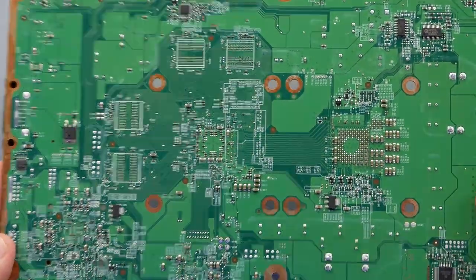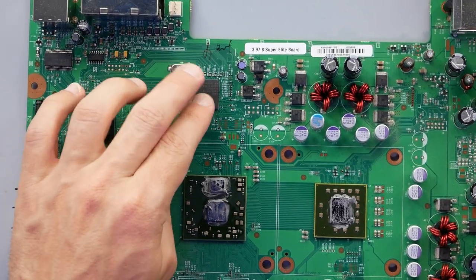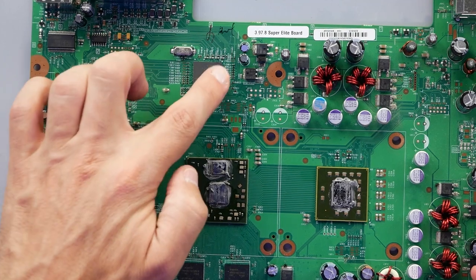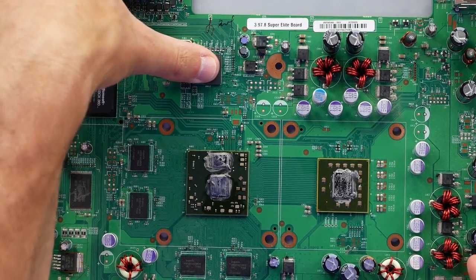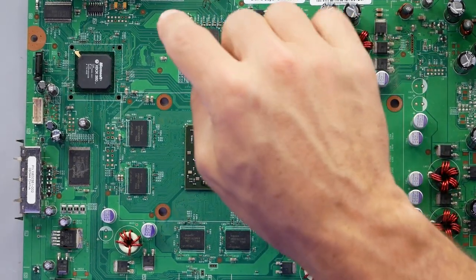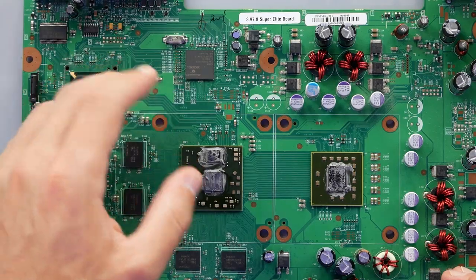While cleaning up, we can take a quick look around the board. We have our RAM modules around the GPU — they also had spots on the back for RAM based on the board configuration. There's the Southbridge up here, the GPU, the CPU, and then this chip right here — the HANA or ANNA chip. That became an important part of the repair and diagnosis cycle because there were different error codes related to it, like E74, which was a big one where you'd get one red light. Sometimes we would test by pushing down on this chip while trying to post it. E74 was very general though and could mean the GPU or this chip. They started moving to 65-nanometer fabrication, which was better, though it introduced its own problems.